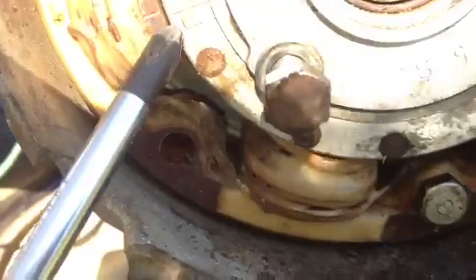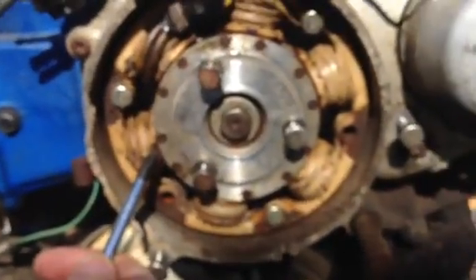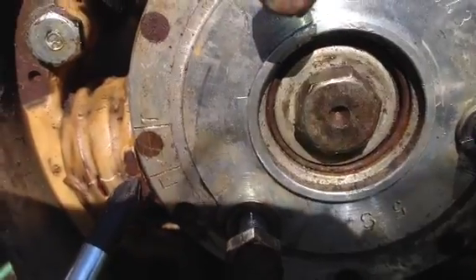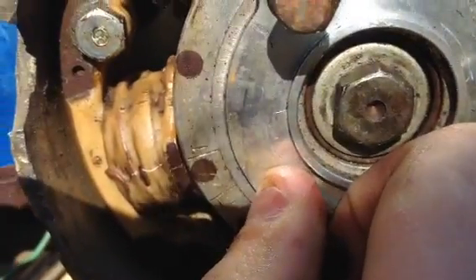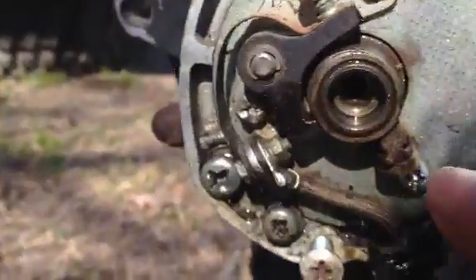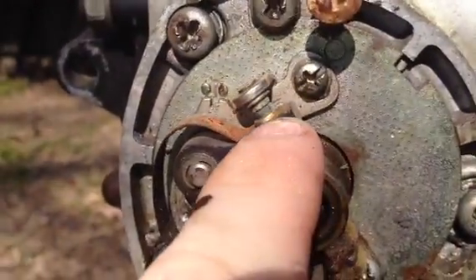The mark on the stator is here — if you're looking at it, it's right there, that little coil. What you do is you line up this mark here with this — like that. And then, for the fire mark, you take and you line this here up, and that's wherever you want it to be lined up for the points to close.